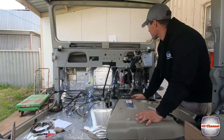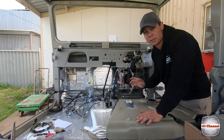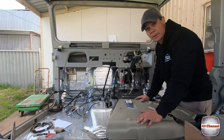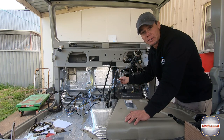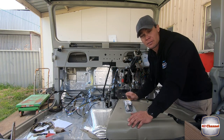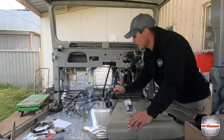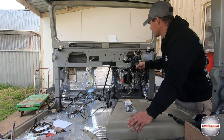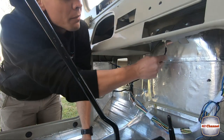So we're still playing with the wiring, there's a little bit more cleaning up to do. Once this main harness is done we've got the rear harness to sort of clean up, but it'll be fairly straightforward. What I've done is just thrown the wiring into the dash before we start wrapping it all up, because I want to make sure that where all the plugs and everything go, I don't wrap them up and make the wiring too short. Ian made a pretty good suggestion on one of the comments - I love it when you guys make comments that help me out - to throw cable ties through it.